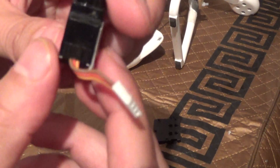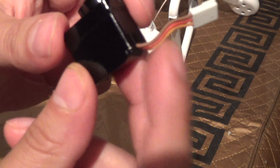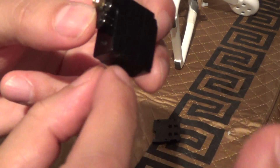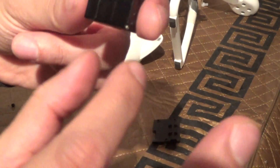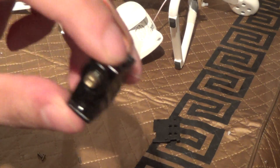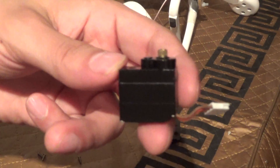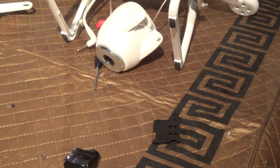This is what it looks like. This to me looks like a standard micro servo. I've also checked the measurements — it's the same measurements as a regular micro servo. The only difference is it doesn't have a fin on either side with a hole you would use to screw it onto something. So you could probably buy an off-the-shelf micro servo, maybe even one that's higher end than this one. I don't know the full specs, other than it clearly has a metal front gear, but you might even be able to get a better one with better response time.